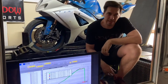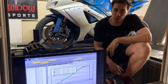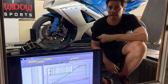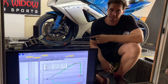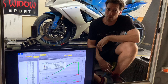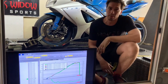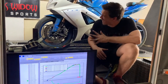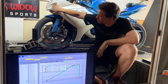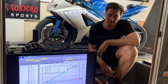So you got to see the four pulls that we made — two of them at low pressure, two at high pressure. Not a huge difference on this particular bike. On some of the ones with better ram air, like a ZX10 — which I'll make a video for when I get one in — we got about a horsepower difference between those two fan speeds. We're not exactly hitting right on the inlet ducts; we're hitting just a little bit below it. I'll make some more in-depth videos in the future.